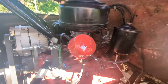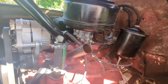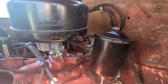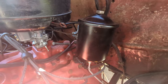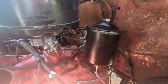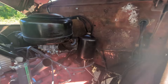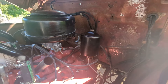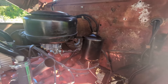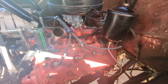This should be a learning experience. Here is where the oil goes in. Probably the biggest difference from other oil changes is that on these older cars the oil filter canister is up here on top rather than down below. My Cadillac is the same way and I changed that just a couple three weeks ago - it can be a challenge because the oil just sits in there. The only way I found to get it out is siphoning - last time I literally used an old turkey baster, probably about 30 turkey baster fulls. That was a bit of a pain.